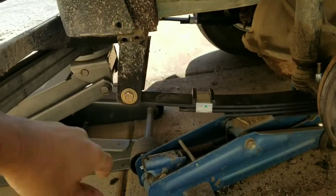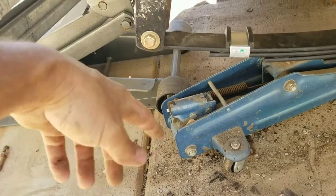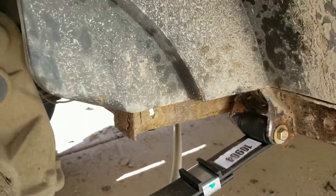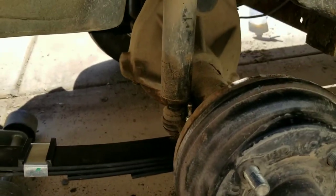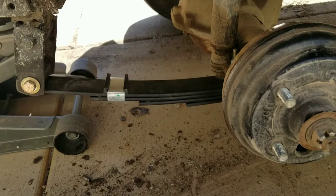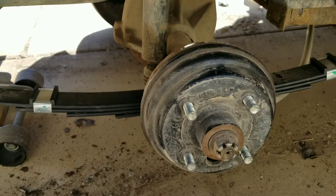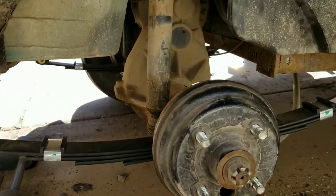All these bolts were completely shot. We cut the bolts out on the back side so we can just put new bolts in. Cut the U-bolts on the very bottom so the whole U-bolts straight came out. Cut the bolt on the front shackle completely out. So you put the leaf springs in, lower the axle shaft, put the wheel back on — and that's pretty much it. Do one side at a time. This brought it up about an inch to inch and a half difference compared to the old side. We gained about an inch with the extra three-leaf heavier duty leaf spring.